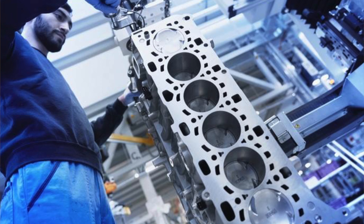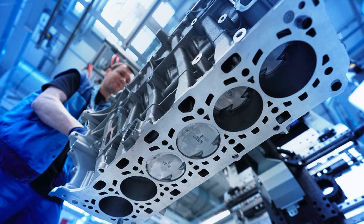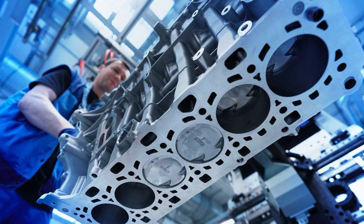This motor has been around for about a year now and so far there's nothing online about anybody spinning crank hubs. The numbers are pretty impressive — the guy who tuned my F80, Paul, uses boot mode and made specifically about 800 horsepower and about 780 to 790 pound-feet of torque. Even if you knock off 50 on each figure, you're still talking about an extra 100 to 150 increase from a fully E85 tune on an S55. This dyno is off a stock motor, stock turbos, stock fuel injectors, and stock fuel system.